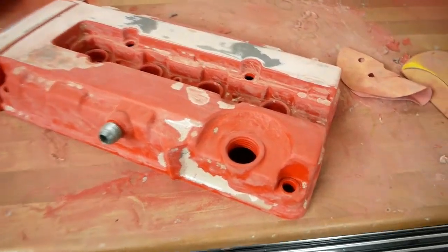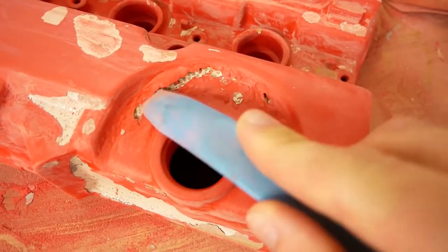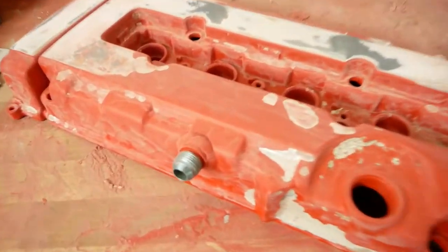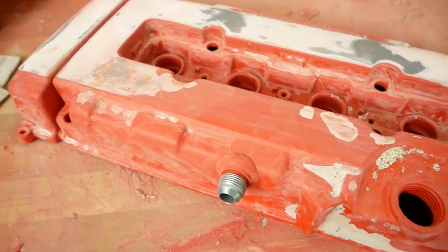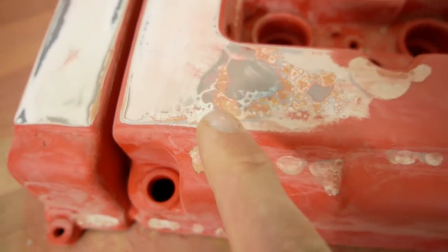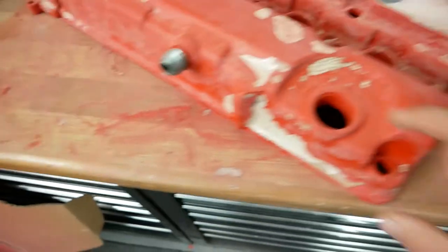You can see I've started prepping it back already but I've left this area here so you can see what I'm talking about — it's just started bubbling and lifting all over the place, just falling off in chunks, not adhered at all. But around this area it's adhered absolutely fine and lovely and solid — and that area was predominantly bare metal where the fitting was welded on. So I think what's happened is the old lacquer underneath has been the issue — it's just not stood up to the heat, and putting it in the oven made it pickle, bubble, and cause this carnage.